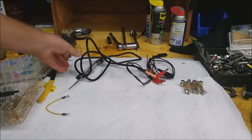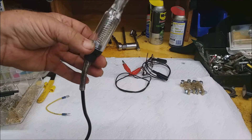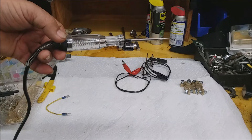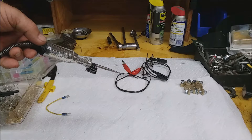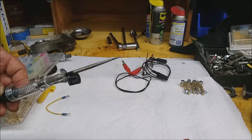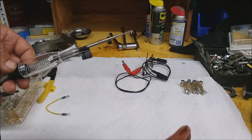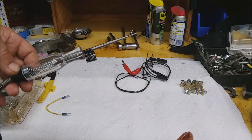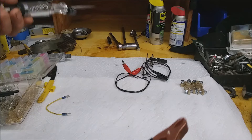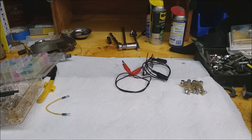Another handy testing item is basically a light — a trouble light. You ground one side and then you go looking for battery voltage. If you're checking electrical wiring and you want to know if there's battery there, this little tip will allow you to go inside of a connector and make a connection without even taking it apart. It's very basic but very useful — ground one side and you can easily find out whether there's battery on a terminal.